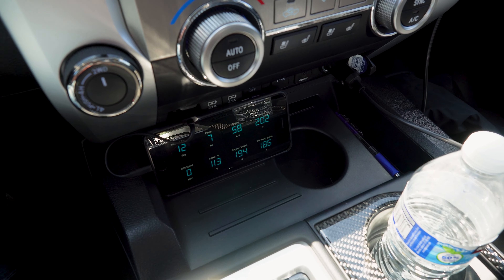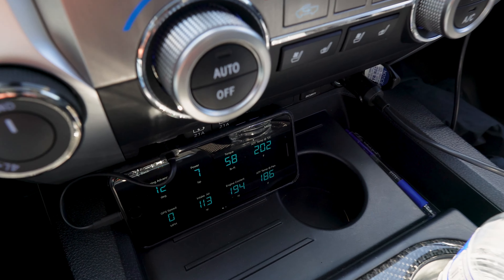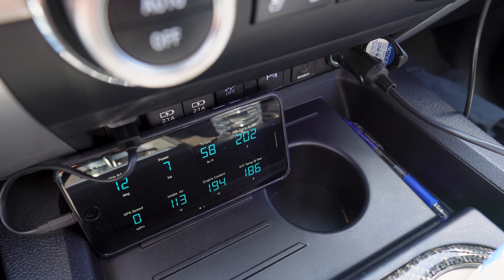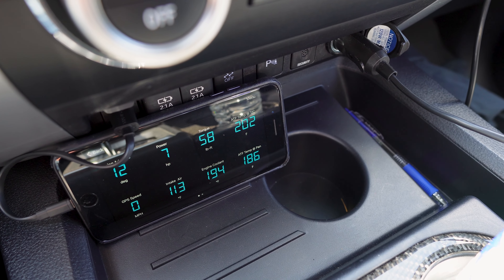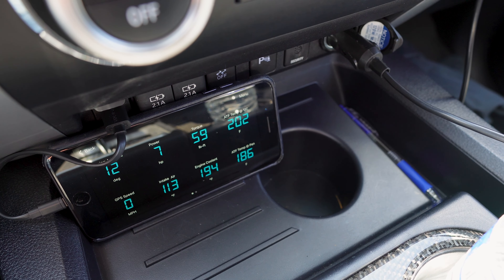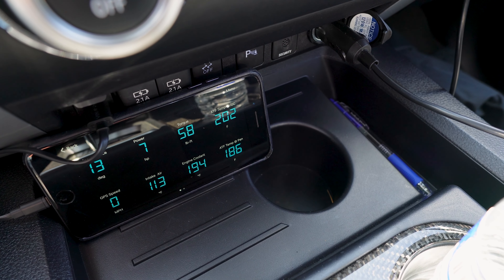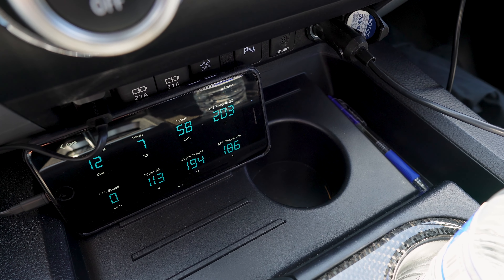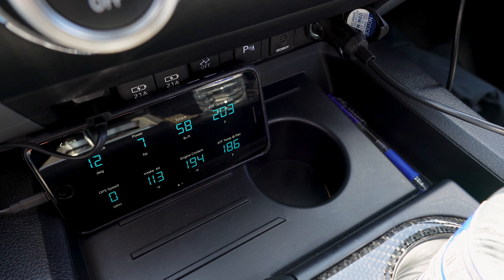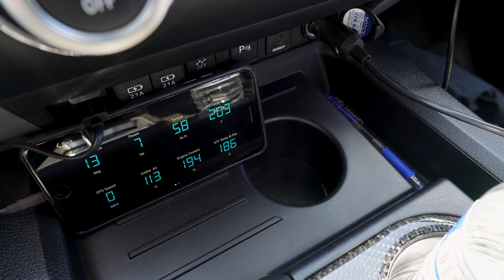This being a 2020 Toyota, they pulled the cooler off factory, but I went ahead and installed the 2007 hard lines and thermostat and then put an aftermarket cooler in the front — I can get some footage of that. That's really key. I would much rather drive it in fourth at 3,000–4,000 RPM than fifth with the torque converter unlocked. The truck is much happier that way — it keeps all your temperatures in check.